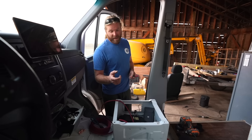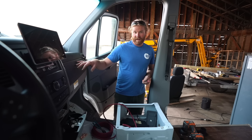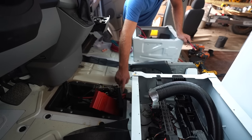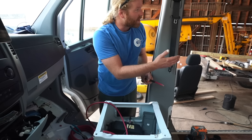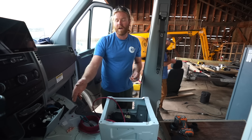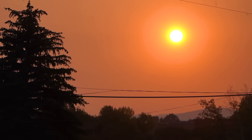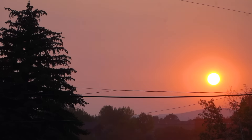So we are trying to charge the house battery off of the alternator from the engine. What we're going to do is take your two-gauge wire, 150-amp fuse protecting the house battery. The ACR charges the rear house battery. If the house battery voltage drops, it'll disconnect so it won't drain your starting battery, so you'll always be able to start. The main point is to always have a charged starting battery and then make sure the house batteries can get charged up from the alternator.